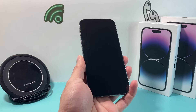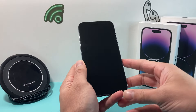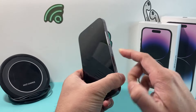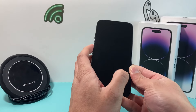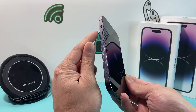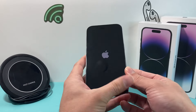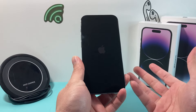Whenever you have this happen, there could be multiple reasons why the phone won't turn on. The best way to try to turn on your phone is doing a forced restart. To do a forced restart, press and release the volume up, then press and release the volume down, and then hold the big side button on your right-hand side. Hold that side button until you see the Apple logo, then let go. Press volume up followed by volume down really quick, then hold that side button.